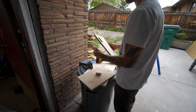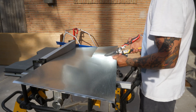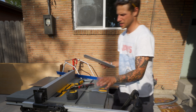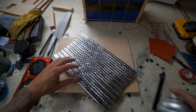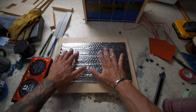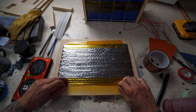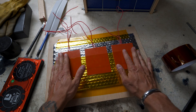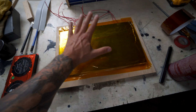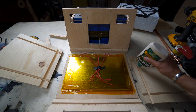Next I put together the base heating pad assembly. I cut a piece of galvanized sheet to the exact size of the bottom of all the cells combined, and did the same with the Reflectix. I laid the Reflectix down first with spray adhesive to keep it in place, then used heat-resistant tape over it since spray adhesive doesn't hold well in heat. I centered and taped down three heating pads, then placed the galvanized sheet on top and taped that down too — covering everything so that if any plastic cell wrapping rubbed off, there'd be no metal-to-metal contact causing a short.